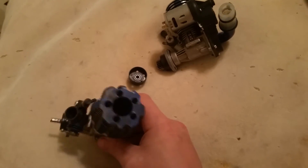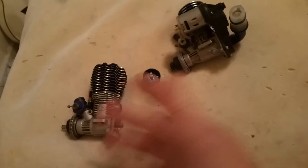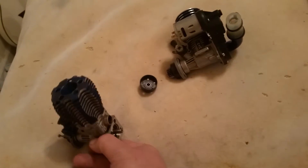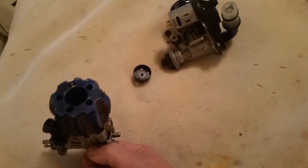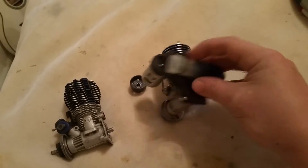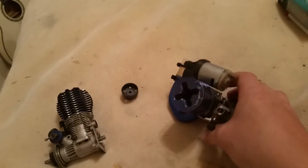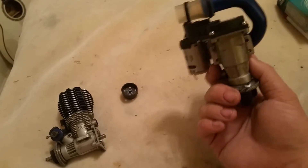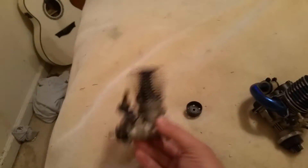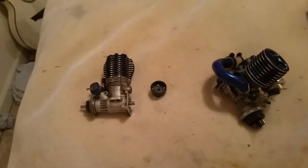Glow plugs are different — some are extremely hot, some are heavy duty, some are medium. They glow at different heat ranges. The racing ones actually glow at a hotter temperature than just a standard Pro 0.15. This one actually has the racing header on it from Traxxas. I had a Nitro Sport that took a crap so I got a Nitro Rustler, and that's what this engine is going to go in — a Nitro Rustler with a 3.3R instead of the 2.5R that comes stock.